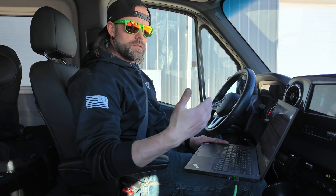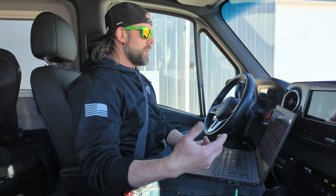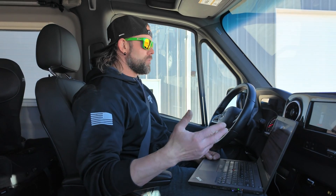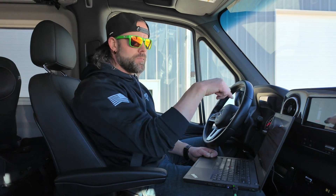It's not a big deal — we do these recalibrations several times a week. It's a really simple procedure assuming you have the proper Mercedes software, which we do. The actual Mercedes procedure is: first, remove the damaged housing, replace it with the new housing, set the sensor angle to the appropriate angle, then go into the computer, clear all the codes, check the current sensor angle, and start a calibration drive. The procedure is to go through those steps and then drive out, following other vehicles, staying around 150 to 250 feet behind them in traffic.